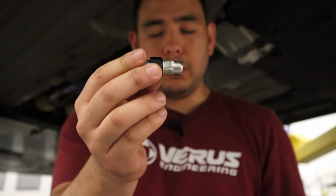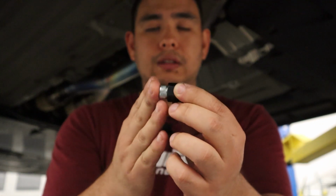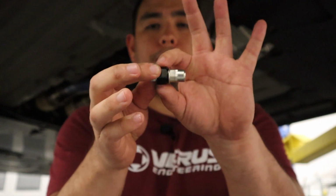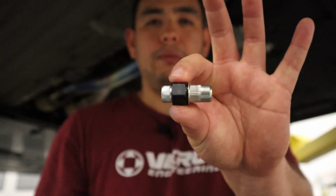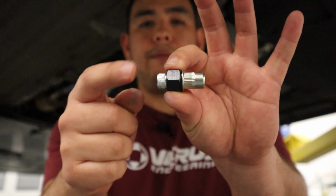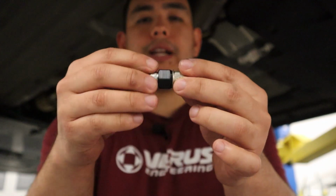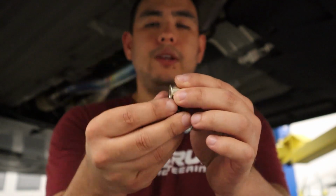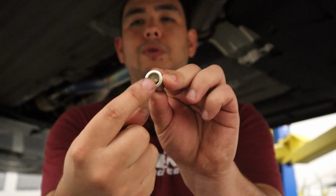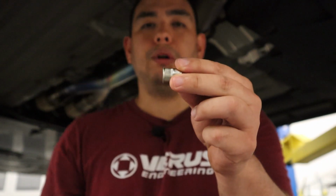You're gonna insert the rivet nut portion into the hole and you're gonna make sure you hold this entire assembly tight against the body, whatever you're trying to put this into. And you're gonna hold back the black portion with the 17 millimeter wrench, and you're gonna start tightening the bolt itself while holding this back again. And you're gonna do that until you get a pretty significant resistance. Once you're satisfied, you'll just pull this out. This portion here should have been sufficiently crushed, and you can look through this end to make sure. And basically, once you have that, this will be permanently installed.